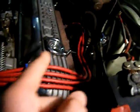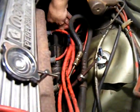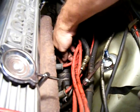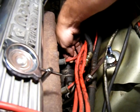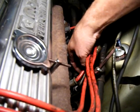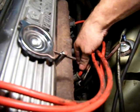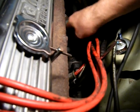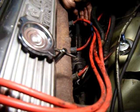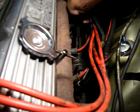Also the plug wires down there near the steering — it's actually rubbing down here. I can feel on the backside here that it's almost through. This one here is rubbing, not nearly as bad, but it is rubbing. And this one here is actually on the power steering itself, which is not a good idea. This car should have had 90-degree boots on it. We need to route it around a lot better, or maybe even put some better wires on here — this one here is rubbing through. It would be a really good idea to fix that up.